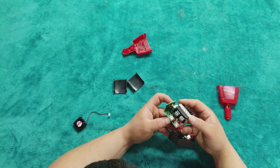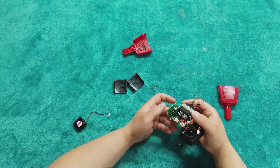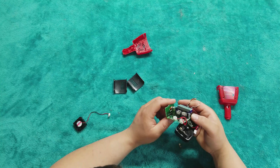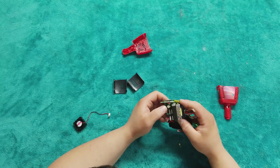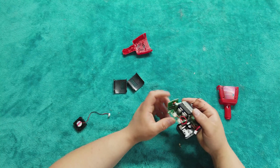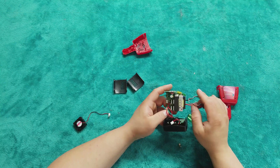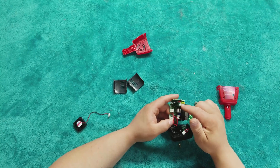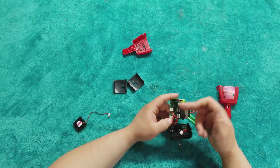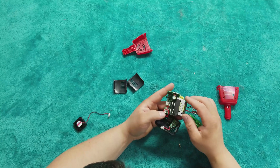There are a couple of large capacitors here. My guess is that the reason there is a brief shutdown is because this capacitor here isn't up to the task of supplying 150 watts all at once. This capacitor charges up and is on standby for low loads, and when you give it a surge draw it drains almost immediately, then the 12 volt charges it back up enough to re-regulate voltage — that's my guess just looking at it.